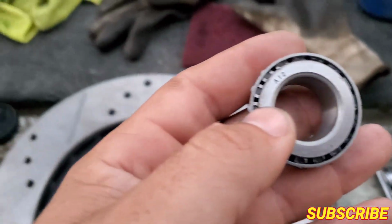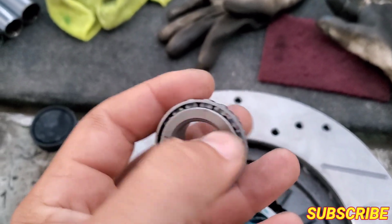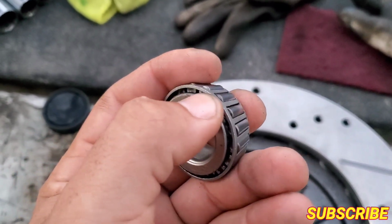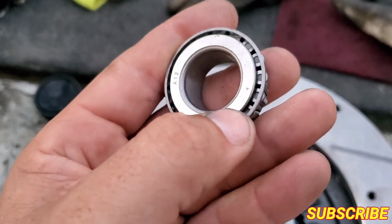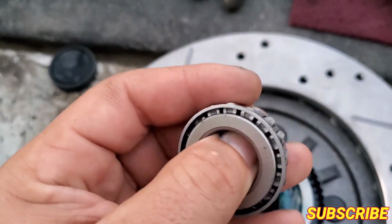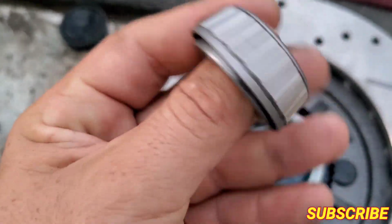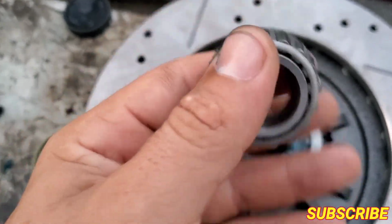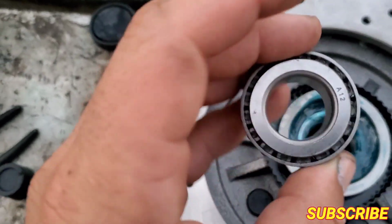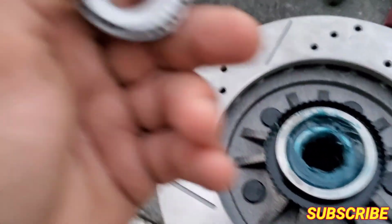So whenever I'm gonna grease them, I don't just grease the sides and all that stuff. No, I grab a bunch and I start stacking it in, stacking it in, until it comes out through this side. You gotta stack them, roll them, keep on stacking them until the air comes out, because sometimes you hear some pops around them. So I like to get them full of grease, man, because these things are gonna go in there and I want them to be performing 100% good. So I like to do my job one time and perfect.